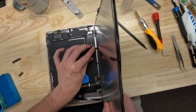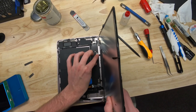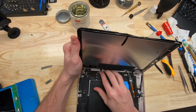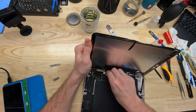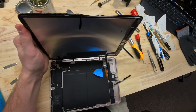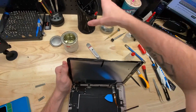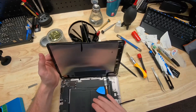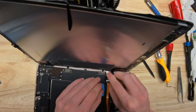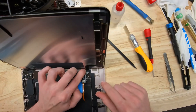Basically, if you don't transfer the screen data on newer iPad screens, the customer's Apple Pencil will still work, but it won't form any straight or diagonal lines — the lines will be squiggly for no reason. For people who use their iPad to draw, create, or take notes for school, it just doesn't look right. They'll come back wondering why the screen is causing that. You want to take care of the customer and get it done right the first time.